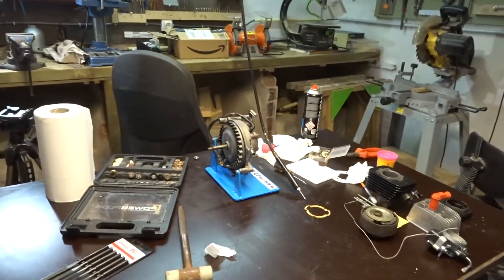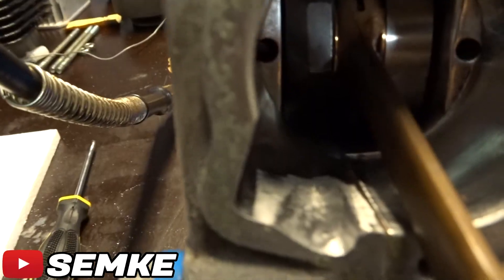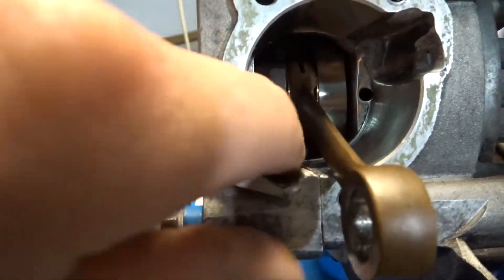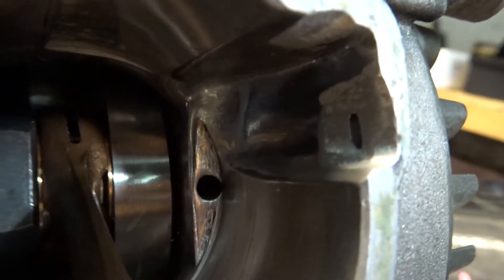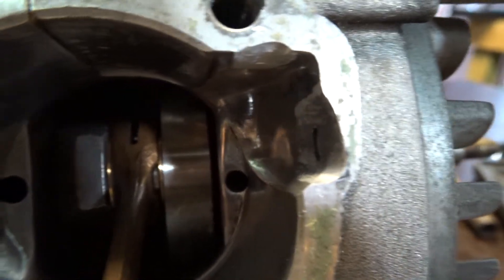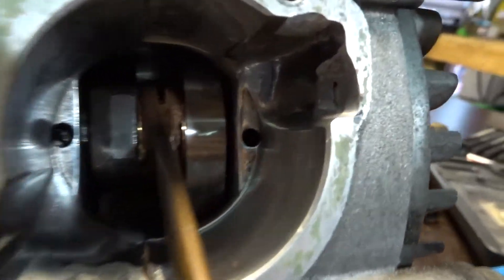So this is the battlefield from grinding away. I'm all done. But of course, with stuff like this there's always problems. So this is my first grinding area and it looks nice and perfect — smooth, good transition, everything perfect. But when we look at here, we got a hole. Now I don't have extreme angles, but because it's so thin right here, I ground through it. Oh no, project lost. Put it in the scrap bin. Nothing can work again now.